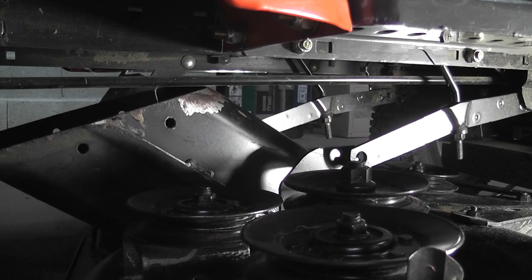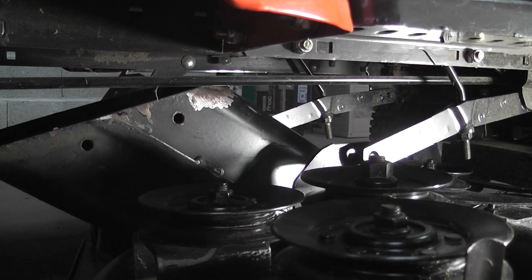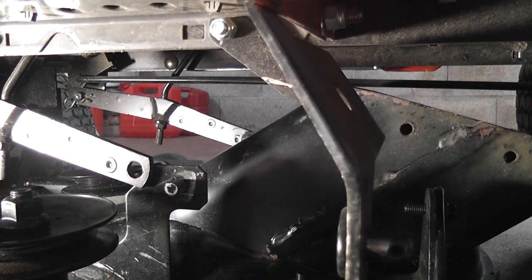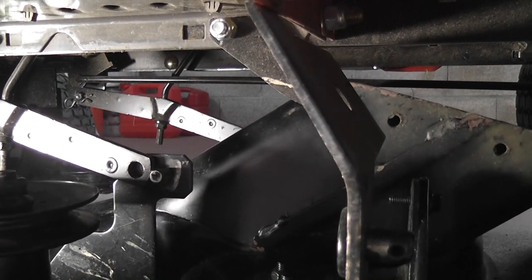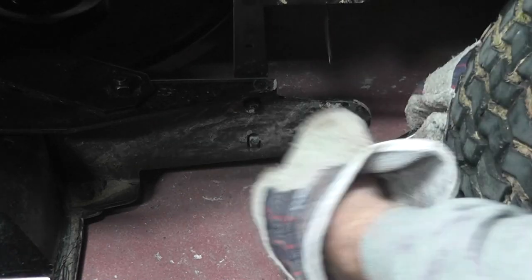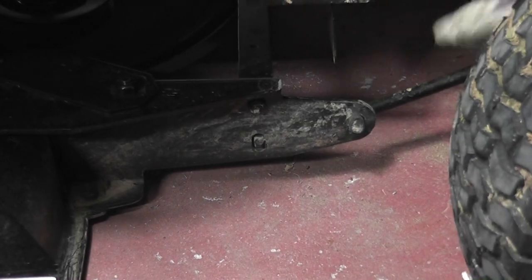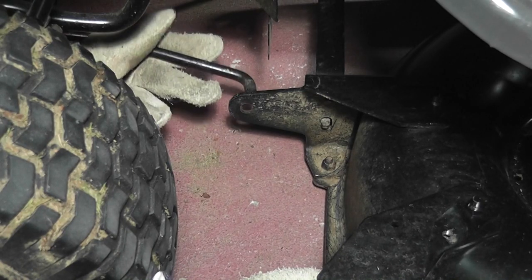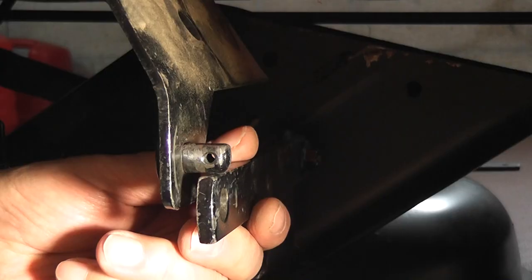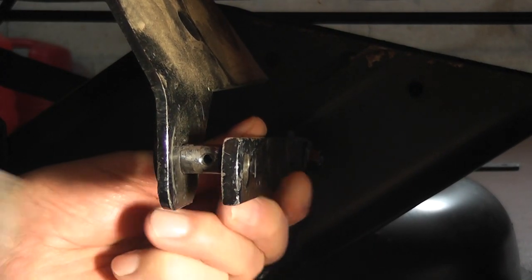Now, levering the screwdriver with one hand, use the other as a guide to lift the right rear of the cutting unit and engage the lug in the hole in the suspension arm. Do the same on the left-hand side of the machine. Next, do the right front one. The left front one. And the last one by the left rear wheel, which, on experience, I decided should have been done first.